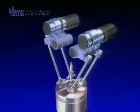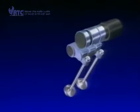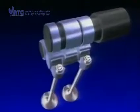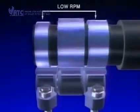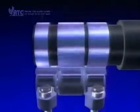The middle rocker arm has a cam lobe which has a slightly different shape to the other two. When the engine revs are low, the valves are being opened and closed by the regular rocker arms, and the middle rocker arm is simply going up and down independently of the others, with absolutely no result for its movement.